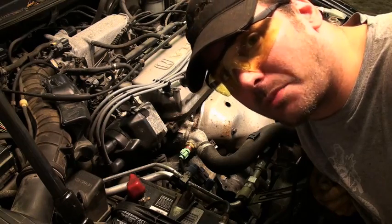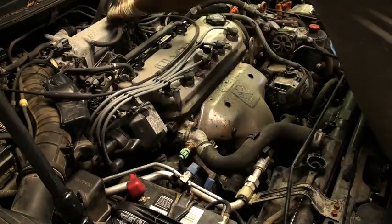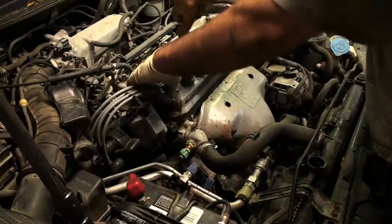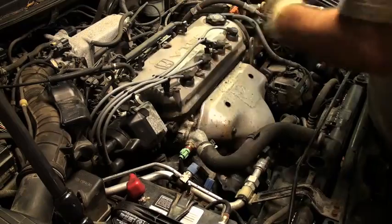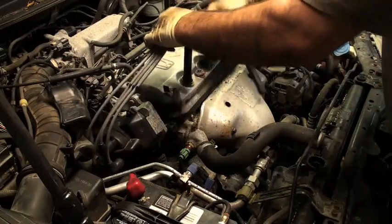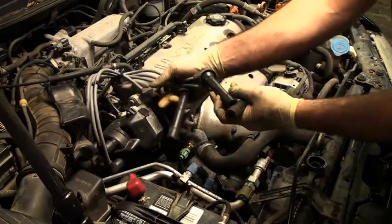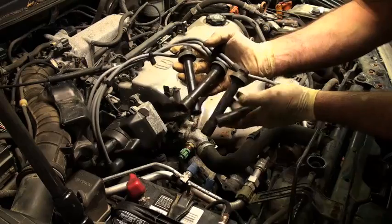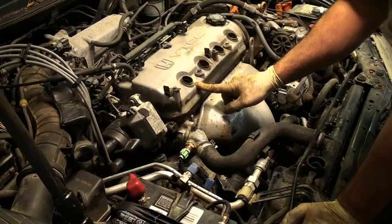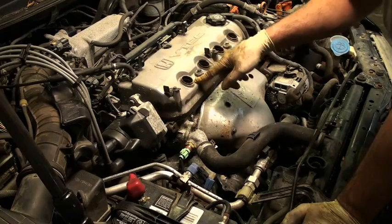You really want this to be as cold as possible. I'm going to get the valve cover off. When you take these things out, look to see if any of the wires are covered with oil. It could be a sign that the gasket underneath is having an issue. This particular style of valve cover is an updated version, but the older style with flat seals underneath — that's the one to watch out for. That's the one that usually has issues with leaks.